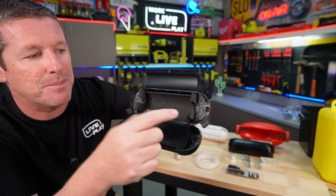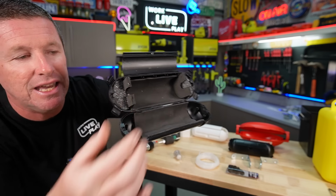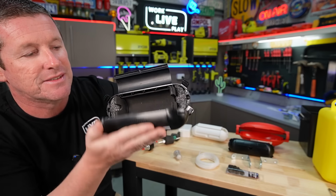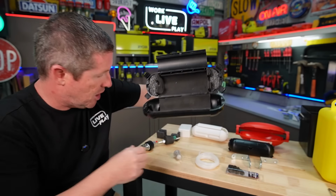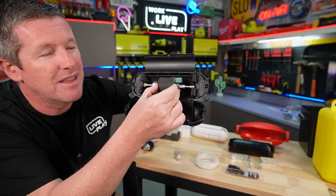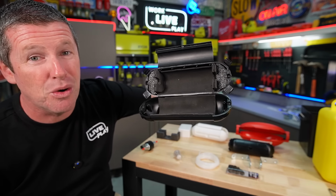I've also done these tabs that run up through the middle. I just made a little cardboard template to cut out some foam pieces that go on either side of the tabs just here. And I just figured that would help cushion it and stop a little bit of the reverberation inside the enclosure. And obviously I've done both sides. So again, it can all fold down and it's got a nice foam enclosure inside where the pump goes. Now you mightn't have to do this other foam because the pump will simply sit in like this. Once you put all your fuel hoses and everything in, that'll hold it into place. But I figured the foam will actually support it a little bit and stop it from moving around. So it's all a bit of an experiment, but I think it will work incredibly well.